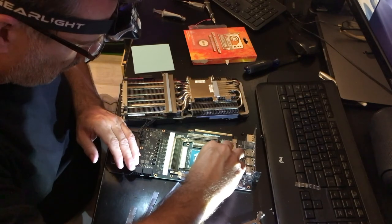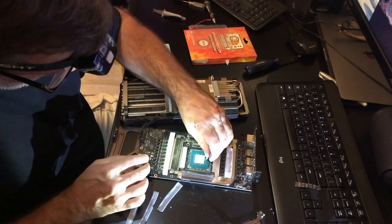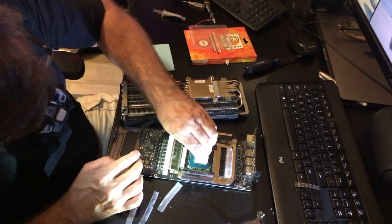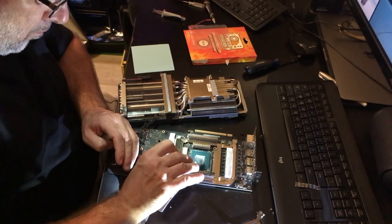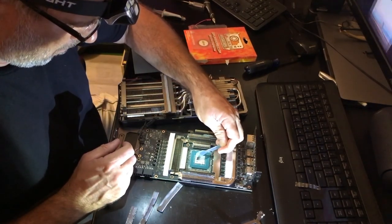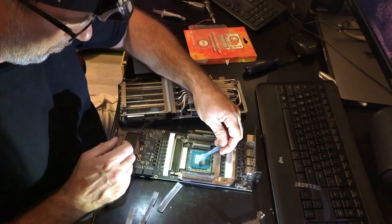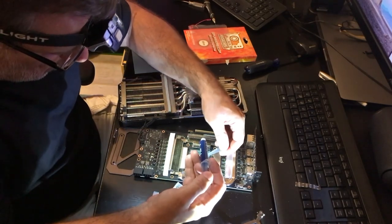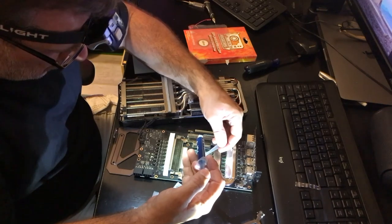The high temps are really just that chip where I'm working - having enough thermal paste on it. The thermal pads typically seem fine, but when you take the thing apart you do put some damage on them because you're ripping the two pieces apart. If the pads are ripped or damaged they're not covering the chips correctly - you'll get heat leakage. Think of the shuttle coming back in with a hole - the heat will seep through and affect the rest of the card. The thermal pads block it, so make sure they're covering everything correctly.